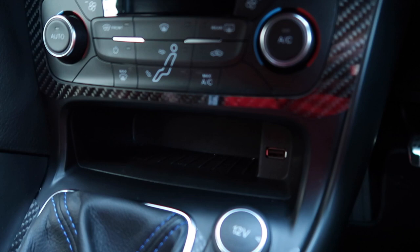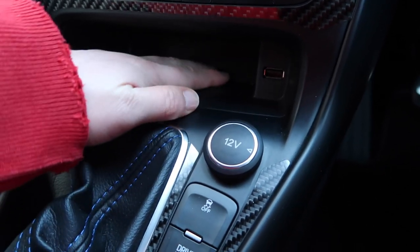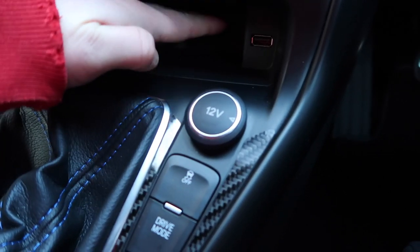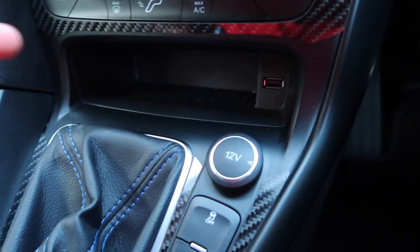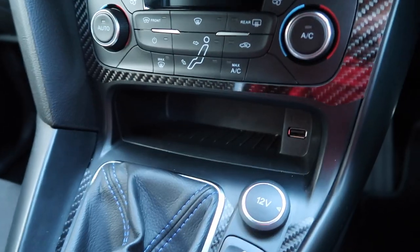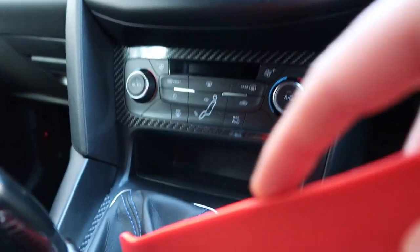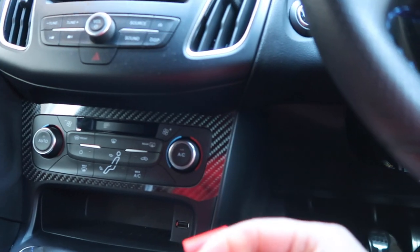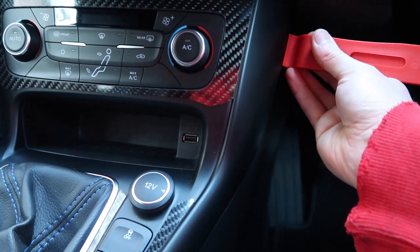In the car, this is the space we are going to be replacing — this whole little unit. We're going to obviously have less space for storing random stuff, but we're still going to have some, and of course we're going to have the charger. Our phone will just slot in here. In order to get this out, it's attached to the wider center console unit, so we do need to dismantle a few things to get in around the back, disconnect, and then we'll get that out. First things first, we need to remove some of this trim. I'm going to start on the top right edge and use plastic trim tools — no metal trim tools because we don't want to damage the plastics.